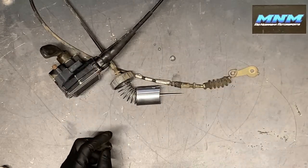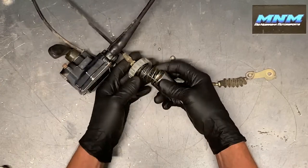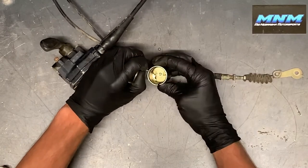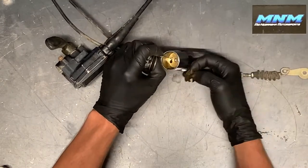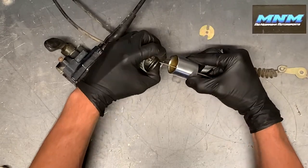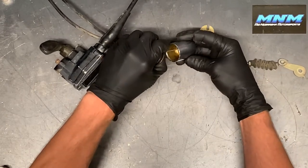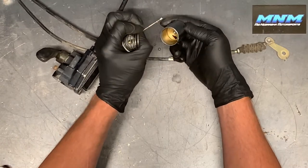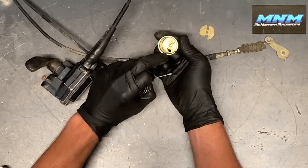I'm going to show you how to remove the sliding needle out of this assembly. I'll take my left hand and pull this spring completely out of that slide. Then you've got a keeper in there — just kind of shake it and that keeper will come out along with your needle, so pay attention to the parts. Now slide your finger back a little, push that cable down — there's a groove on your slide that the cable will slide into. Push it down slightly and it fits in that groove, then pull it out through the larger of the two holes.